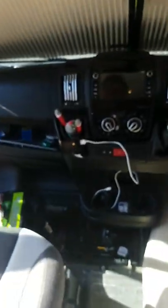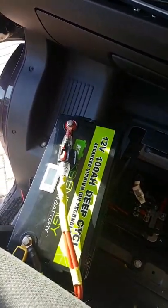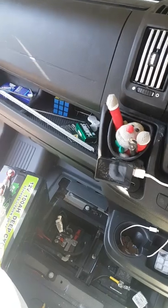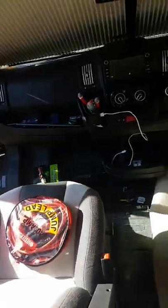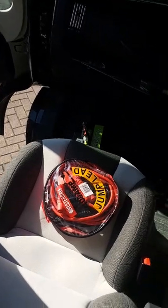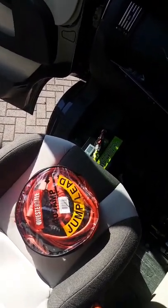Up front we've got the vehicle battery — that's the Ducato's vehicle battery — and then we've got a KS100 Lithium battery, and that's paralleled with a second Lithium battery living under this seat. So we've got 200 amp-hour of Lithium iron phosphate KS Energy batteries available. I'm going to hook these up via heavy duty cables and an amp clamp meter, and measure exactly what current they'll be drawing when the batteries switch off.